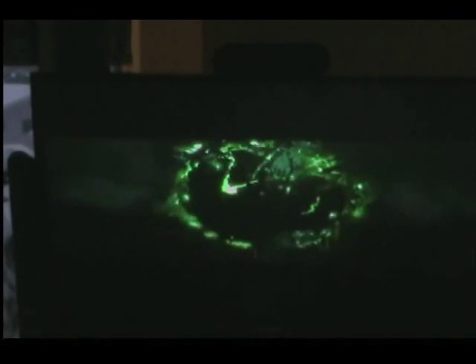I'm going to replace the LED in my TV. As you can see, my TV does not have any red. There are three LEDs — a blue, a green, and a red — and apparently my red lamp went out. It kind of went out all of a sudden, it wasn't something that happened over time. I've got the part for it, cost me $104 from GlobalSemi.com. There's nothing wrong with the picture really, just a missing red, so all my reds are black.